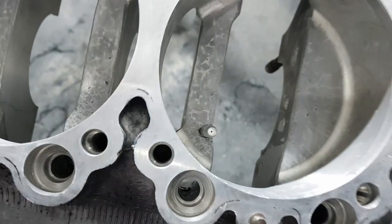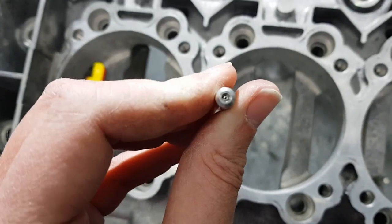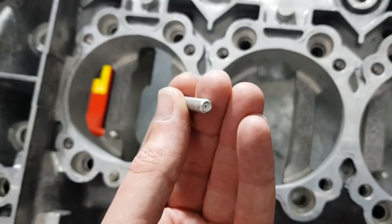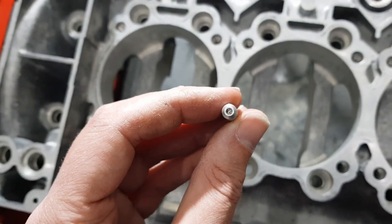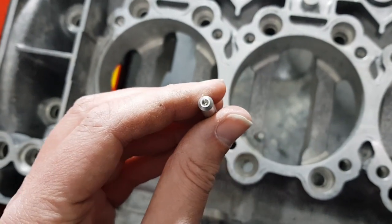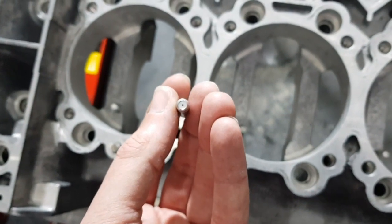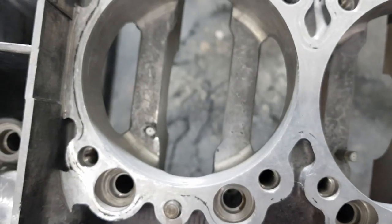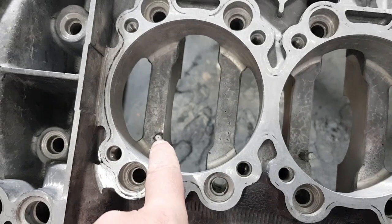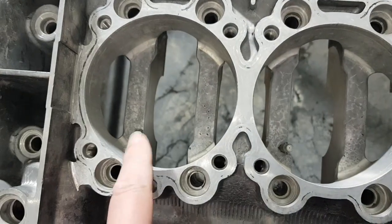These basically consist of a ball bearing — you can probably just see it in the bottom — and then there's a spring inside. The ball is held against the back of the squirter by the pressure of the spring. This means that when the engine is idling and oil pressure is low, it isn't squirting a lot of oil onto the bottom of the pistons, which don't need cooling then. When the engine speeds up and oil pressure rises, it pushes the spring away and oil is free to squirt through the hole onto the bottom of the pistons. This block has one squirter per piston — three in each half. Some blocks have dual oilers with two per piston, but this early block doesn't.